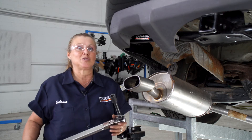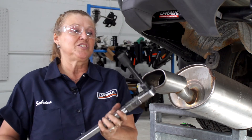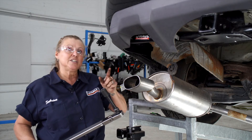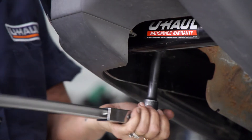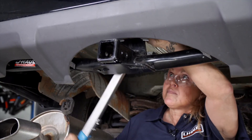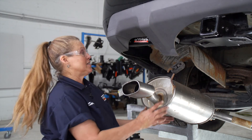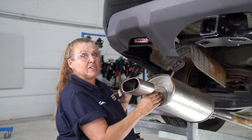So let's get these bolts torqued down to the manufacturer's specs. We're going to use a torque wrench, a five inch extension, a 19mm socket for the frame bolts, and a 16mm socket for the middle bolts. Now that we have all the hardware in place and torqued for the hitch, we're going to finish up by reinstalling the exhaust and then we'll get this vehicle back on the ground.